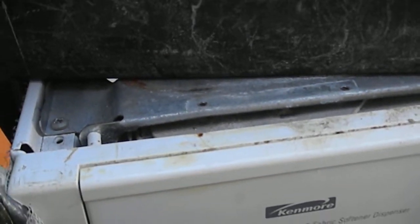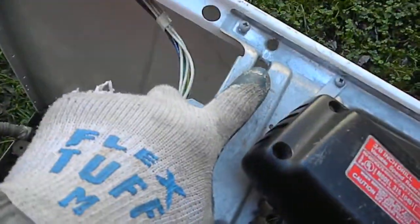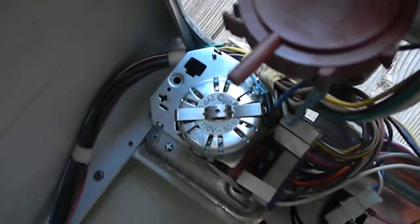In order to take it apart you're gonna have to do the obvious of course. There are a couple of nuts up here that hold the top mount spring in place. Also there's a seal — sometimes you have to cut these seals off, sometimes they're spring loaded so you can pop the spring off the bottom. Of course disconnect the shock absorbers and all the other various and sundry items, including the water level sensor.